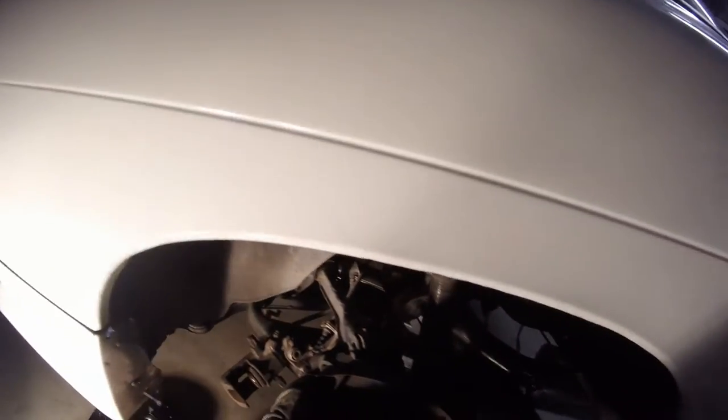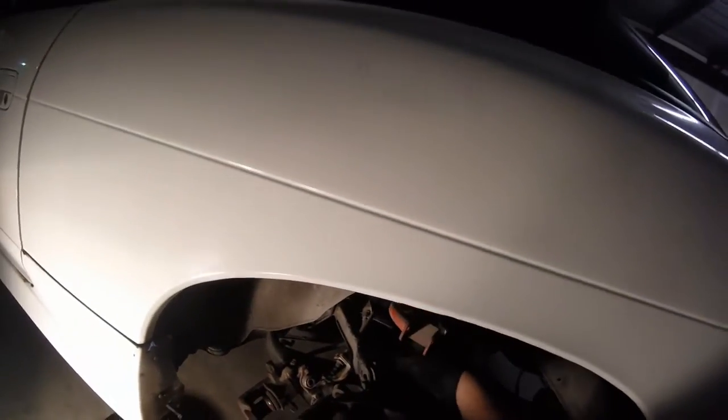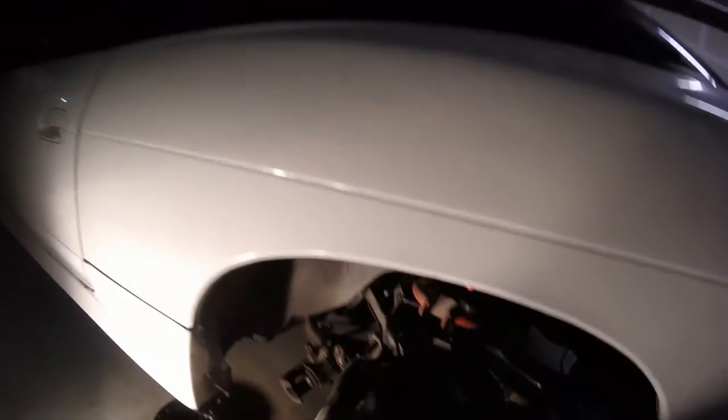Now the reason I'm undoing all this is because the axle of the CV shaft kind of blocks part of the bolt, so it's really hard to, I mean, you could probably get a wrench in there and just fight with it. I'd rather just take off four bolts and then let the thing come down so I can hit it with the impact and be done with it in, you know, 5 minutes. So everybody has their own way. I'm sure somebody's gonna tell me, you're doing it wrong, you're making it more work than it should be. Really, it's not that hard to take these bolts off.